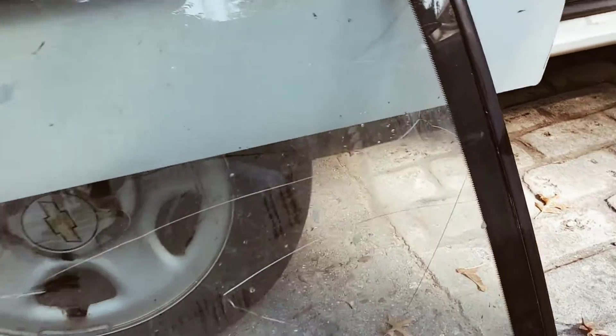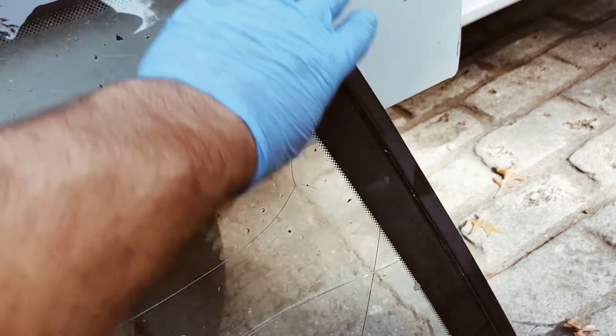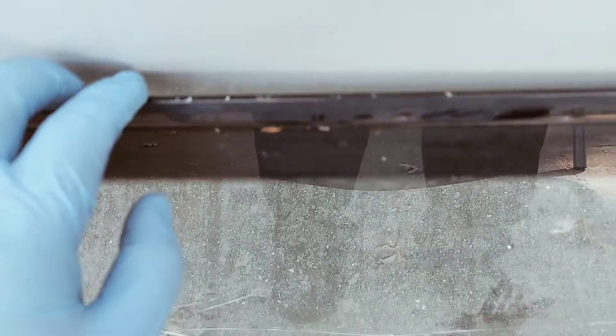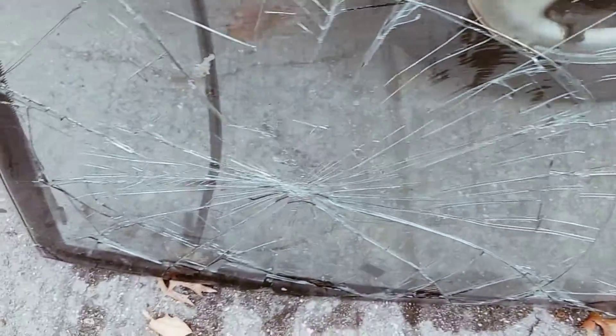I just want to give you a little heads up: this molding, when you take the glass out, is already on the glass. You've got to be careful not to break it — it's metal and it's bonded with the glass, but it comes off once you take the glass off the body. So don't pull this molding without taking the glass out first.